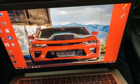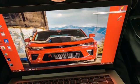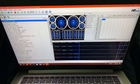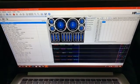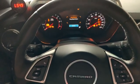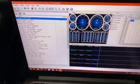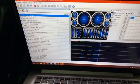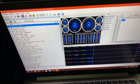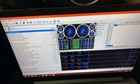Fire it up. Go over here to VCM Scanner, start that one up. Press and hold the power button on your car so you power everything on. Go back down here — on your top left area of the screen you've got 'Connect.' I'm now gonna start scanning and fire it up because I want it to cold start while being able to watch the information.